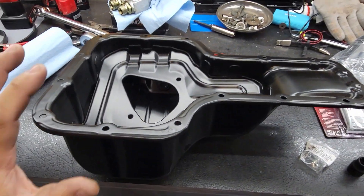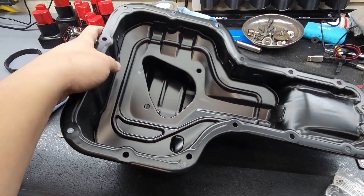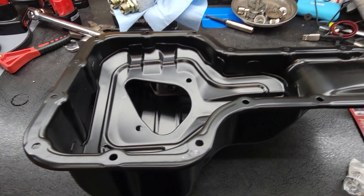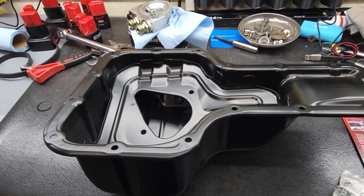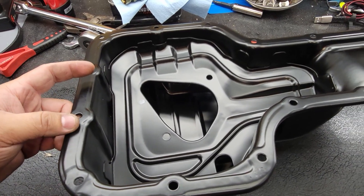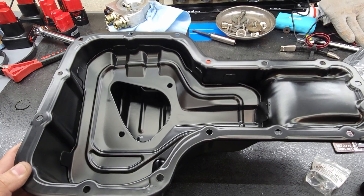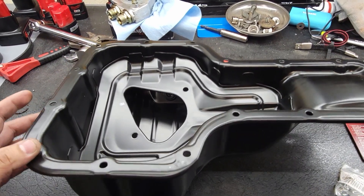I was on Monkey Wrench Racing and they do have a new oil pan — it's a baffled one. The stock one is non-baffled. There are aftermarket ones from Moroso, BOE, and isokinetic — those are bigger capacity and have been discussed for a cooling effect. I decided not to go that route, and this baffled one will probably help for what I'm going to use this car for — maybe some autocrossing.